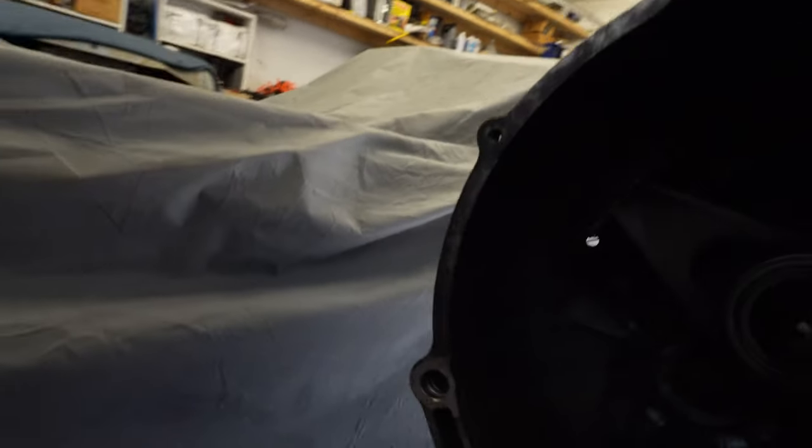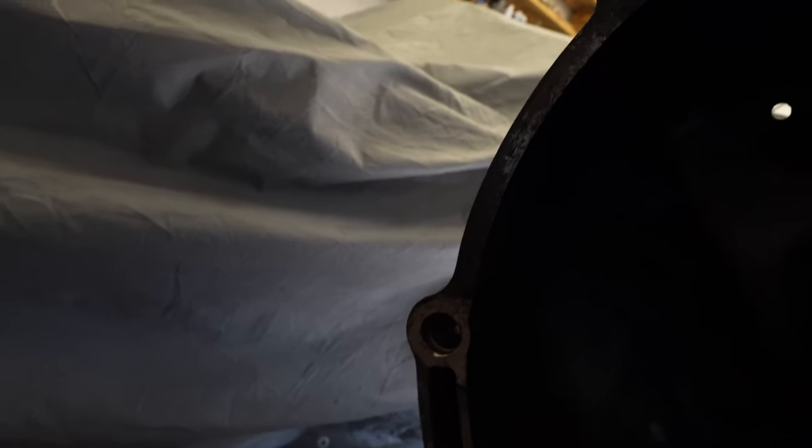Okay, there's no possibility that we don't get some while-you're-in-there-itis happening during this little operation here. One of the things that I bought was a metal pivot pin for the clutch fork. And well, while the transmission is off, right under here, take that off. That spring out of the way. This is a brand new spring. I don't feel the need to replace it.